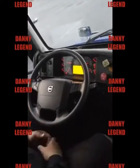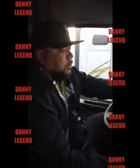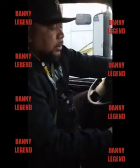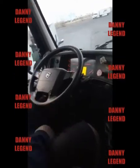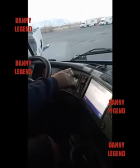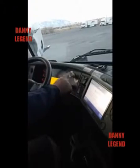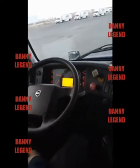Now I'm gonna tell you a story — I want you to tell the story and then perform it. If I fan my brakes down to 60, I should get two indications, either a visual or an audio, letting me know that I'm losing air. Primary and secondary will usually blow up red. If I continue to fan my brakes down to 40, my trailer should pop. If I continue down to 20, my tractor should pop — but sometimes they pop out together. So the numbers are: 60, 40, and 20. Now I'm gonna perform it — it's almost at 60, so I'm gonna pump my brakes until I get an indication.